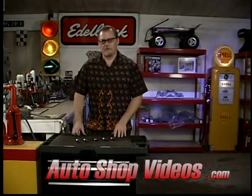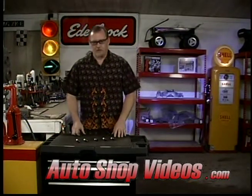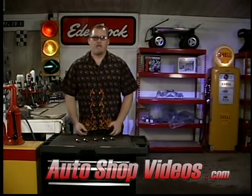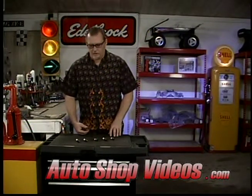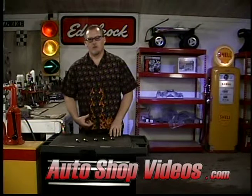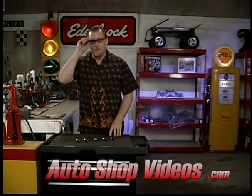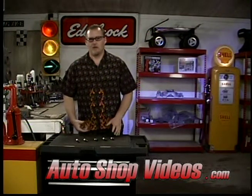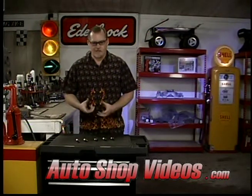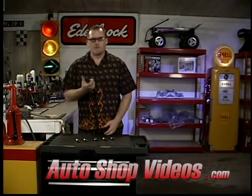Another aspect of ignition are spark plugs. There are all kinds of different types of spark plugs, heat ranges, and things like that. General rule of thumb: performance engines like to use a colder spark plug, and that just means what temperature the spark plug itself is going to run at. There's a misconception that if you run too hot of a spark plug it'll make the engine run hot — and that's wrong. Spark plugs don't have any heat to them; they're just a place for the spark energy to jump a gap, and that's all it's for.